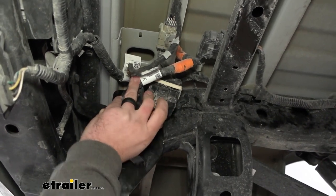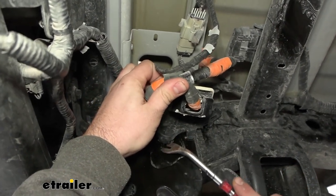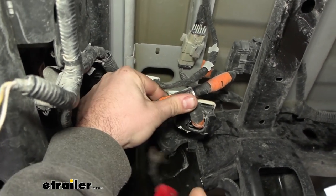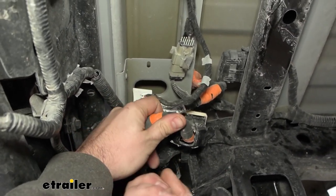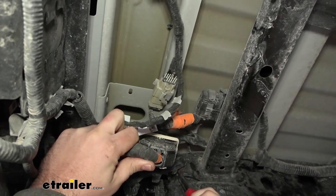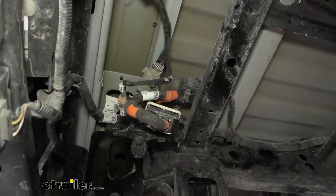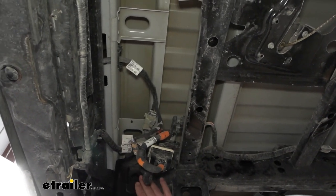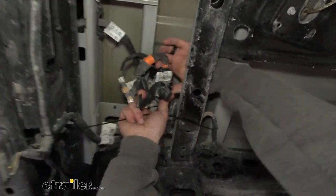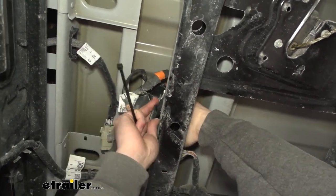On our driver's side, we have a large harness that we'll need to remove. There's a circular part that clips into the frame rail with tabs on it. I recommend using a flathead screwdriver — just push one of the tabs in, there's going to be one on the other side, and put a little backwards pressure to pull this out. There's also a plastic pushpin in the frame, so we'll just pry this off. I recommend getting this zip tied up out of the way because we're going to be mounting up some hardware, so just run this up over the cross member and zip tie it out of the way.